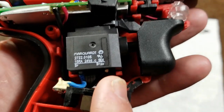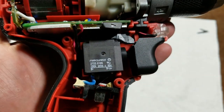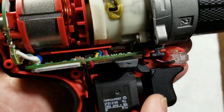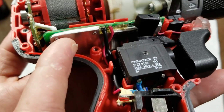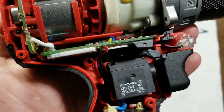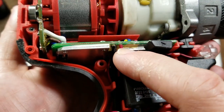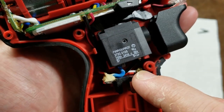We can see they're using a 24-volt trigger switch, so they're probably using the same capacity switch on all their tools. Here's the brushless controller — since they laid all the chips flat, they've screwed in a big aluminum heat sink to the bottom of it to handle all that power. It is covered in lacquer, and they did hot-glue the wires down to prevent fatigue, which is good to see.